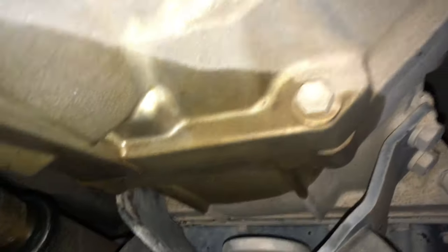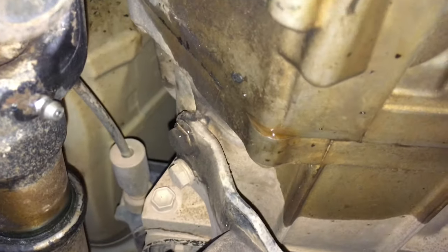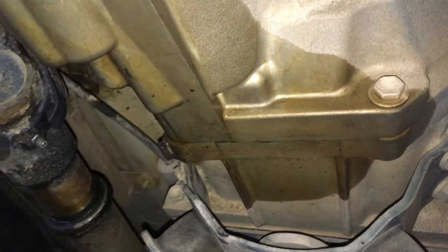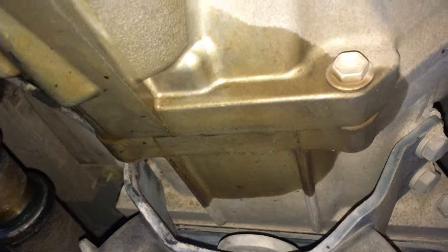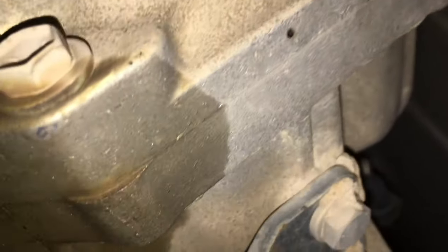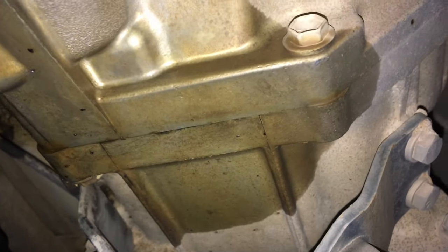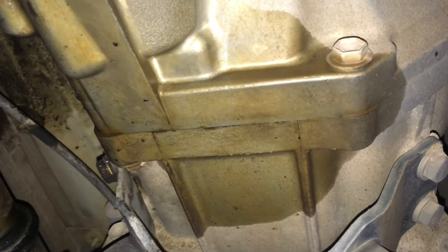Well, I don't see a drip there. It's a little bit damp. What is it? Well, I don't know. Never had to repair one of these because I haven't seen one bad enough. We had one recently. I'm not sure if I did a video or even released a video yet. Where we may consider, look, you can hide the oil leak by smearing RTV silicone along that join there. That's not really fixing the oil leak, it's kind of hiding it, but that small amount of oil, it might just make it look tidy. But this one, I don't even think it deserves a smear.